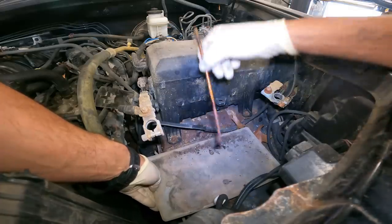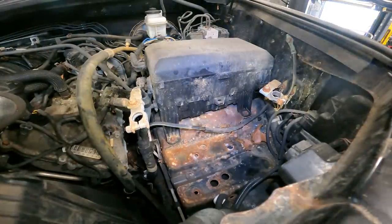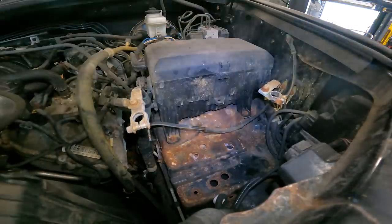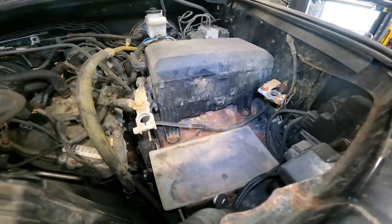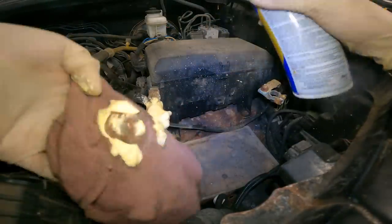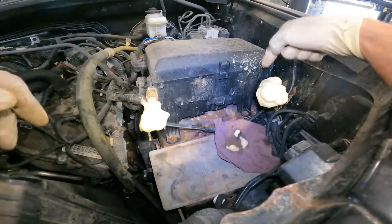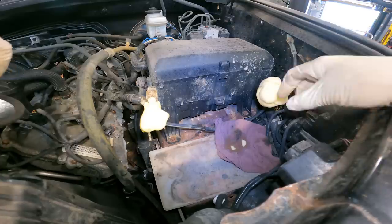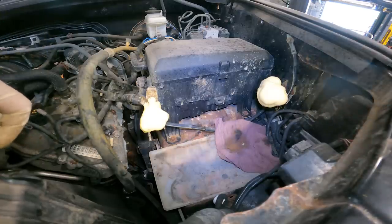We need to get the battery tray out carefully without dropping all that crud off of it. There's quite a bit of buildup in this battery tray area. This acid cleaner should eat through it — let that sit for a bit. We'll get the terminals too. If it's foaming, you know it's working. On really bad terminals, that yellow foam will actually turn a purplish-blue color while it's dissolving the acid.